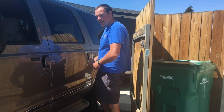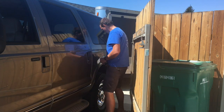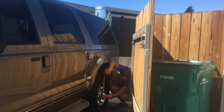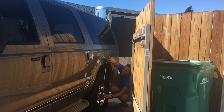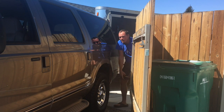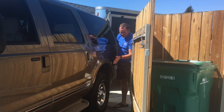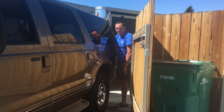Give me just a second here. Let's measure. It's tight because the trailer's sitting in here. So this sits from the center of the hub to the bottom of the fender at 23 and 3 quarters. This is where it sits stock — same size tires as mine — and tires don't matter because we're measuring from the center of the hub to the fender.